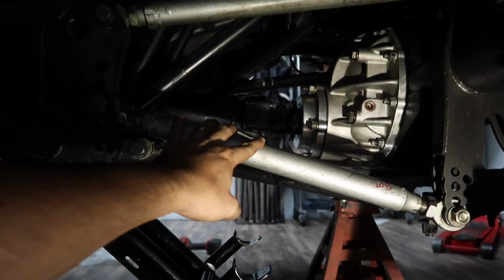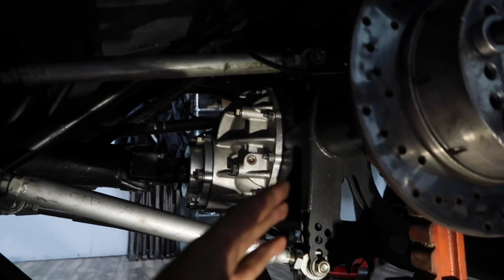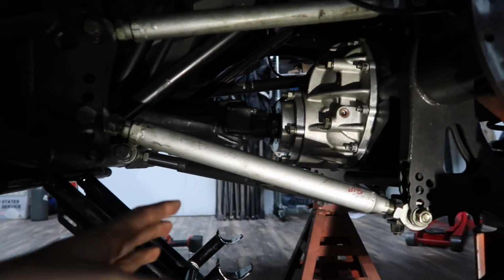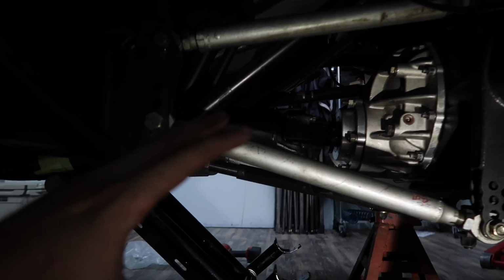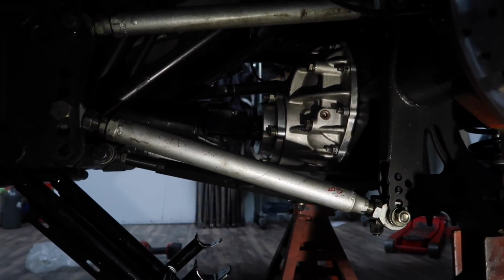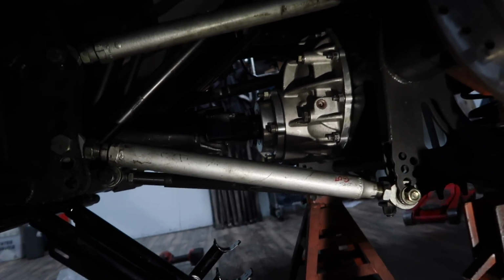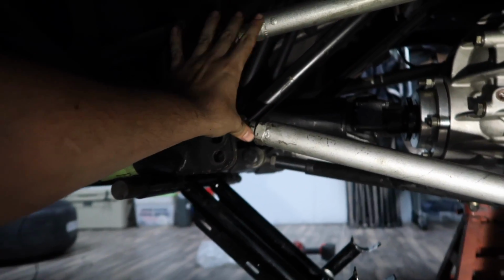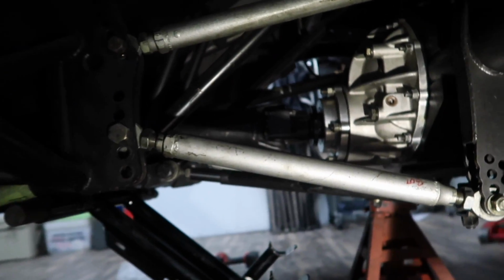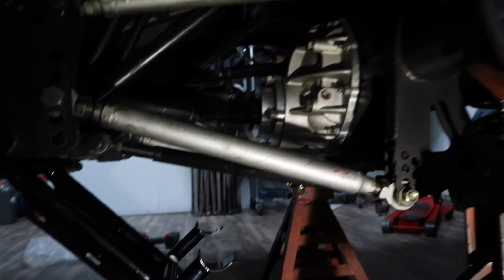We weren't leaving with a ton of power, but we were leaving with some pretty good power. We were going 104 in the 60 foot. We were topping out the shock at like 1 second into the run, and everything was going good. We got this new motor from Kevin Mullins, TCAM Performance, and it's just an absolute monster. We're topping the shock out way early on the same adjustments, and we were just beating the hell out of the rear end. Having this so narrow, it was separating so fast that a combination of a little bit more power and this aggressive bar angle, it wasn't really working.